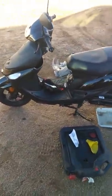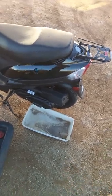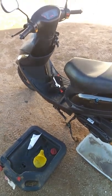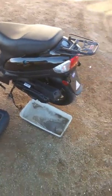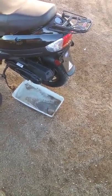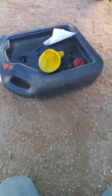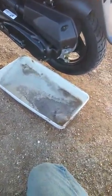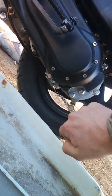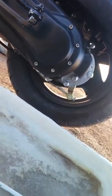This video is on the 50cc TaoTao scooter — I'm going to change the gear oil. If you watched my previous video, I changed the engine oil right over here. I just finished filling that back up, ran it a little bit to warm up the gear so it drains easier. When the gears are cold — like today here in Colorado — the oil is just thick, so I ran it a little bit.